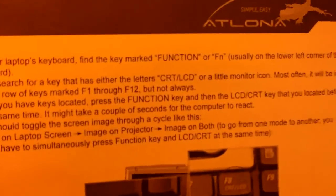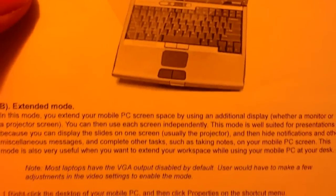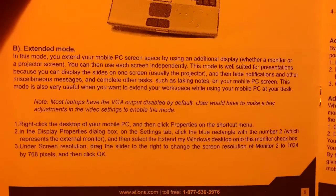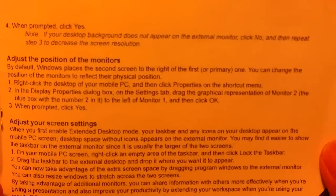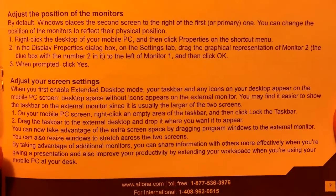The HD510 has a loop out for the VGA. Bear in mind, it doesn't output any scaled image that would be seen through the HDMI signal. It's an optional output for the user to hook up a local monitor. It would make sense if, for example, you wanted to give a presentation off of a desktop computer on an HDTV for the audience, and use a regular monitor to see what you're doing without turning your head or something.